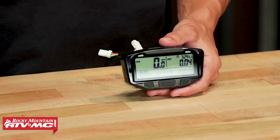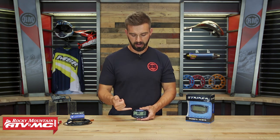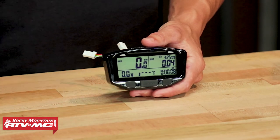A couple of features I like about this: beyond the three screens we walked through, you also have a temperature warning where you can program it to show an LED when you've reached a certain max engine temperature. You also have a voltmeter warning — if you're using a certain amount of voltage from your battery, it will warn you. And there is a maintenance reminder: aside from the hour meter, a little icon will pop up letting you know it's time to do some maintenance, and you can program that as well.